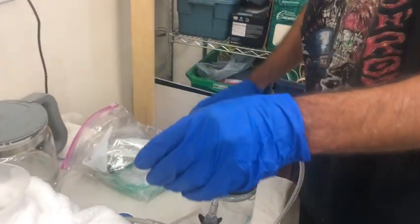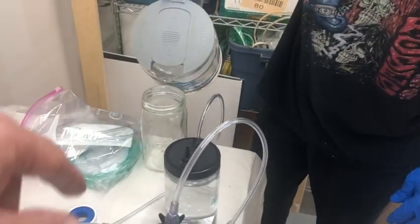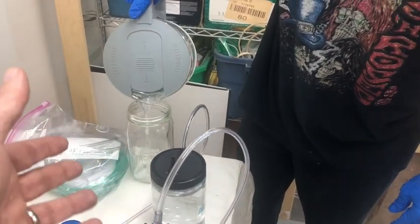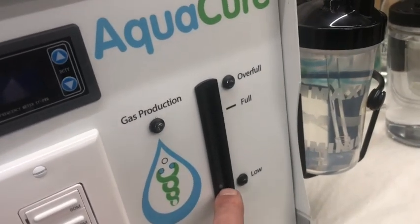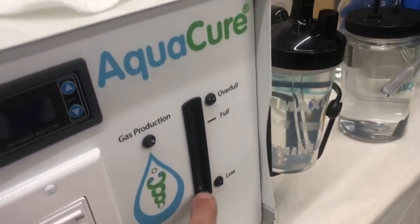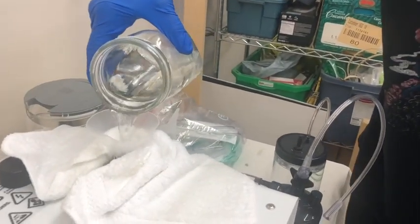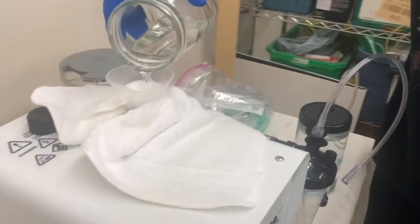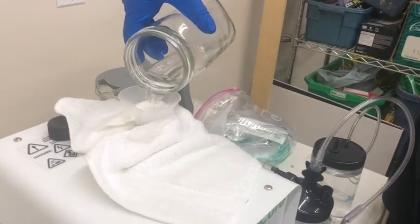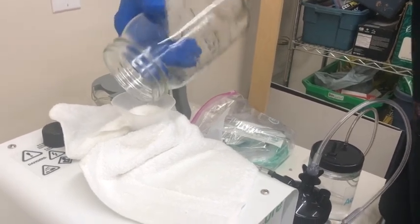Now the next thing, we'll put in 2 cups of water, so about half full, because it takes about a liter or a quart and a quarter to bring it up into about this range here. See, that didn't actually float the ball. That just brings it to a point where it'll perhaps start floating. So now we put another half a liter or half a quart into the machine. You just pour it right in. And then we don't worry about filling it full. That's it, that's all we do, done.